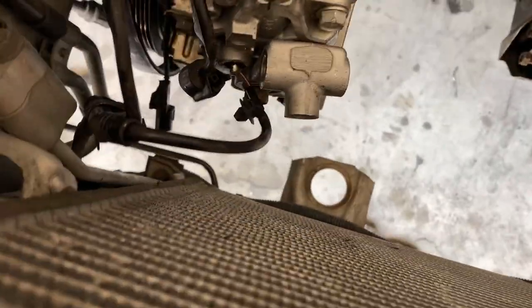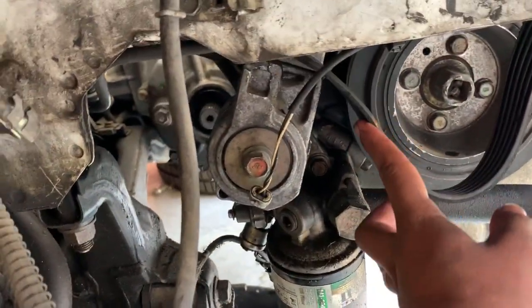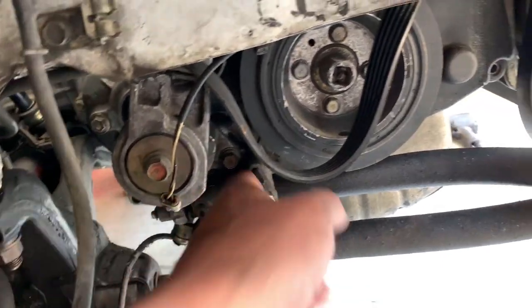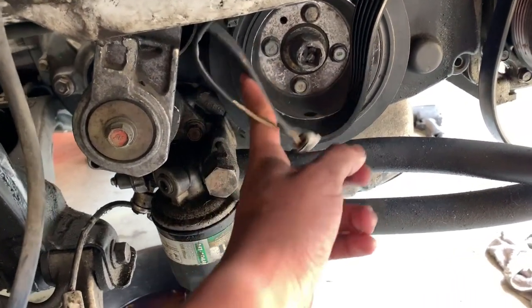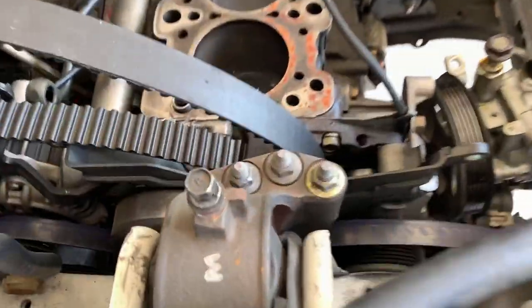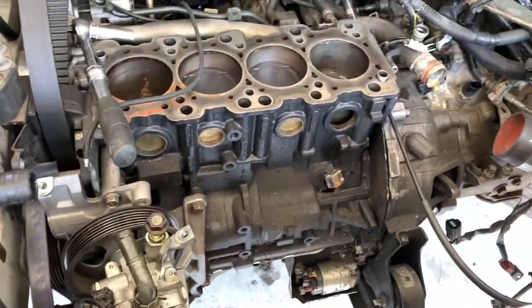Steering is out, just leaving it on top because I can't disconnect this wire right here, so that's why I had to remove it. And it was a pain in the butt because if you see here, it's broken, and this is where I put my half inch. It's notorious, most Evos end up breaking. Bad flaw from Mitsubishi. Well, I was able to put a screwdriver there and pry it that way and get it done. And it's a little pain in the ass because it's just me working on it right now. So yeah, all that's left is to disconnect the diff in the back and then drop this motor and tranny from the bottom, and let's see how it goes.